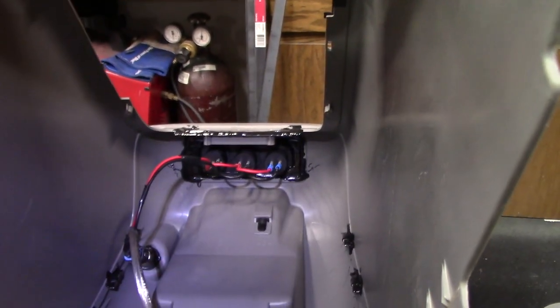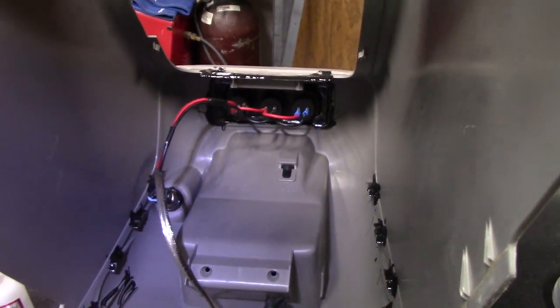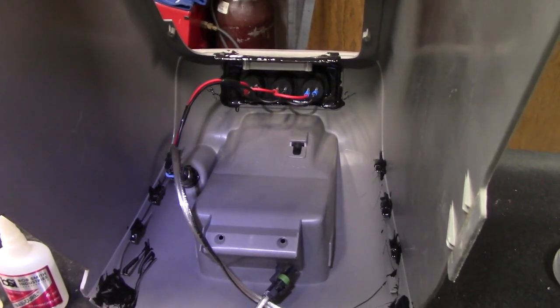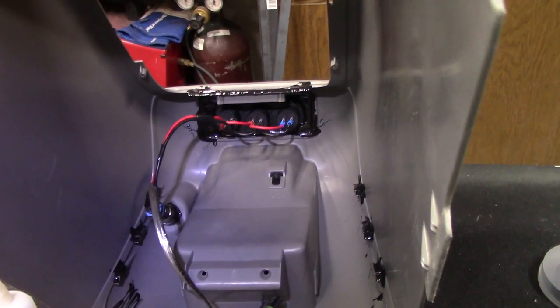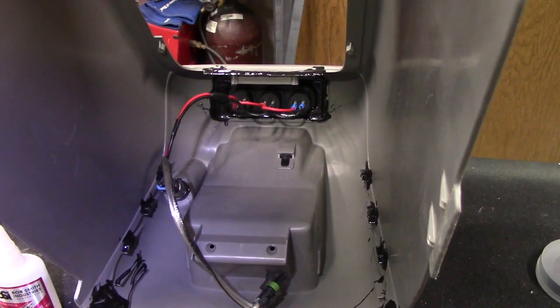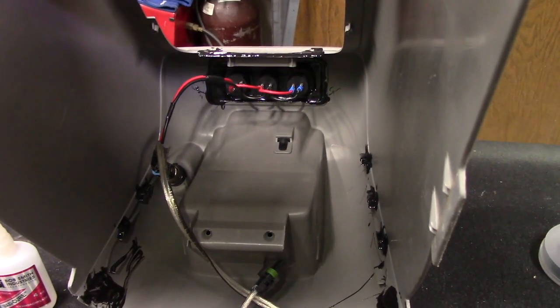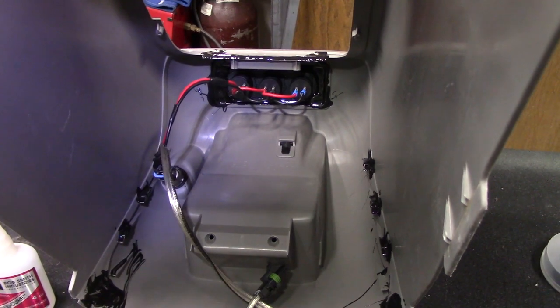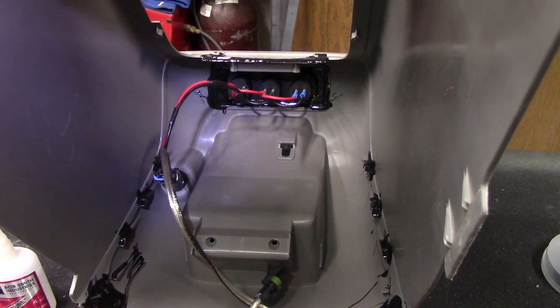I got the wiring done there. And I've upgraded everything. The factory was 18 gauge. I've done everything up to 14 gauge because that's four different power ports that'll be on the back side of this for different entertainment devices, whether it be the Kindles or a TV, a little back-of-the-headrest TV screen for the video player.